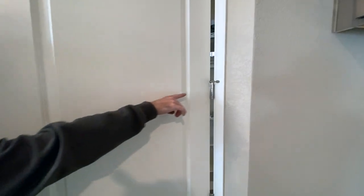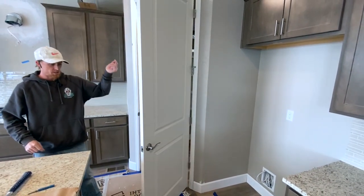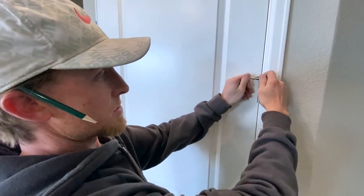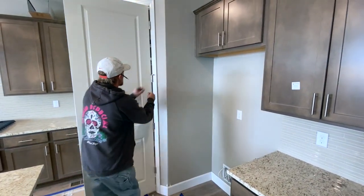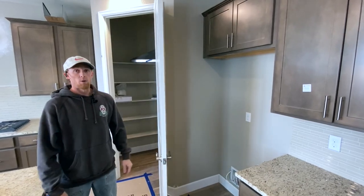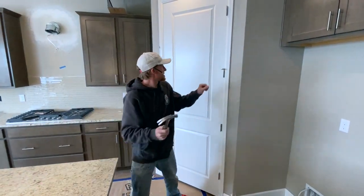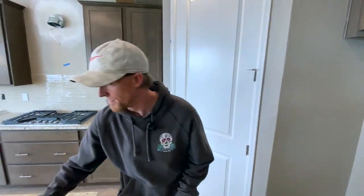Now when the door opens, it's just pinching right here on the hinge, hitting the rubber — and it's stopping the door. We want it to open a little more, so adjust by moving the small screw. Now the door opens a bit more. In this condition for the fridge, the door is going to stop nicely — the fridge comes out to about this point, so you won't hit or dent anything. Over time, if you flex it a couple times, just come back and re-tap that pin down to re-secure it.